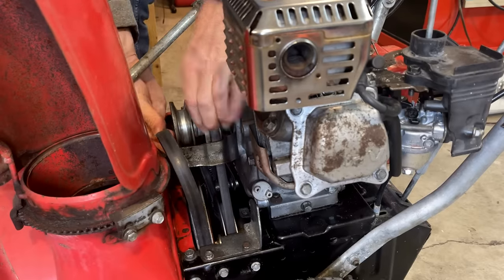So I'm left with, you know, a possible issue with wear. But I'm not really seeing excessive wear. I mean, I can see some shiny spots, but I can't feel it. So I don't think that's the issue. It looks like an adjustment here, where if I loosen these nuts here, I can kind of slide the handle and orient it a little differently on this plate here. So I think that's the next move. See if that makes any difference. Worse.